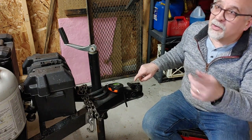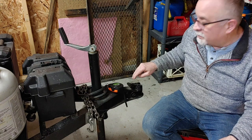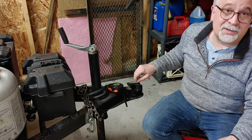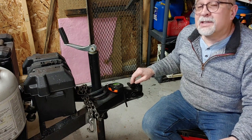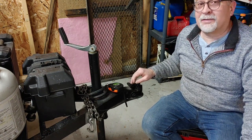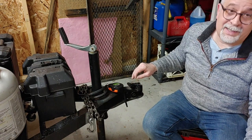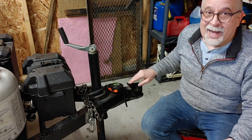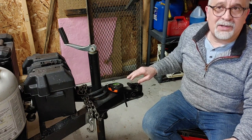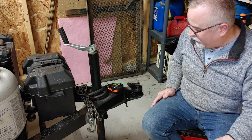This particular one, because of the way the trailer is laid out, is heavier. I am at about 242 pounds, which is about 15%. I can speak from experience that regardless of the speed I've had this up to, being towed behind a relatively small lightweight tow vehicle — a Kia Soul — it never wags. There's just nothing there. It never causes a bit of worry or issues at all.